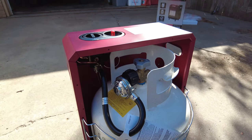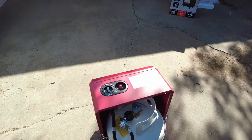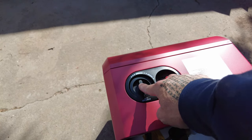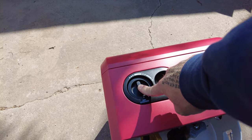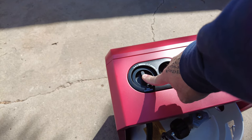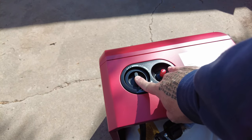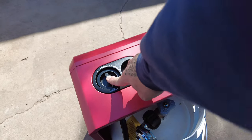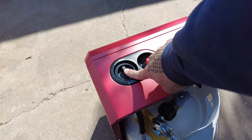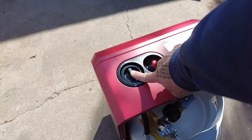We've got no leaks here. The next thing you want to do — if this is a brand new bottle or if you have unhooked it — you need to press this down for 30 seconds. See how that depresses there? That just kind of pre-lights everything and gets any air out of the system so that it is pure gas when you get ready to light. When we get ready to light, we're going to hold this down and press our ignite button, then once it's lit we keep this held down for 30 seconds because that heats up the thermocouple, and then you can let go and adjust the temperature.